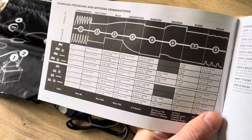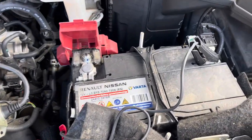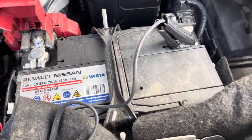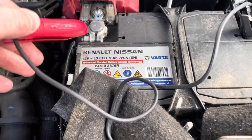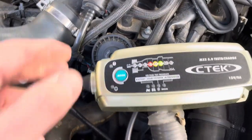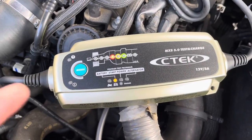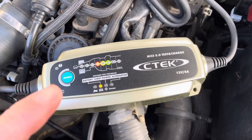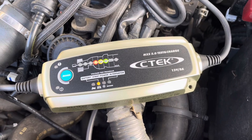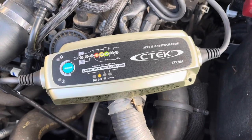The program clearly explains voltage and amperage. Now we should connect. I've already attached the black clamp to the ground and now I can connect the positive one to the other terminal — and you can see it is already blinking. Let's do the battery test. The red light shines. I have to say, you have to do this at five degrees ambient temperature or higher. It's not far from freezing here right now, so conditions aren't ideal, but I know my battery isn't charged well enough.